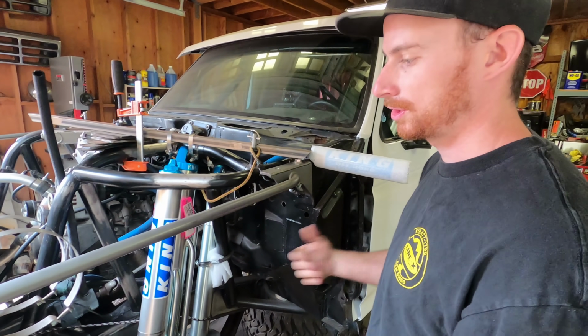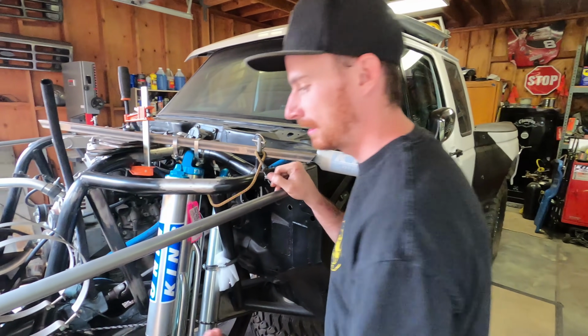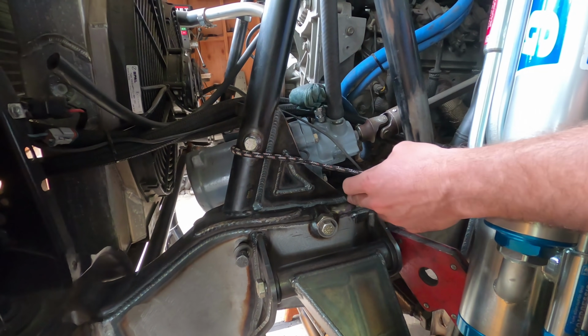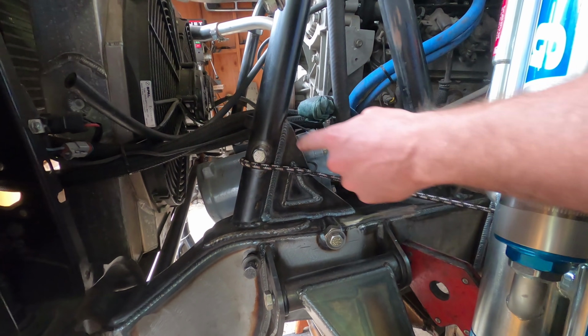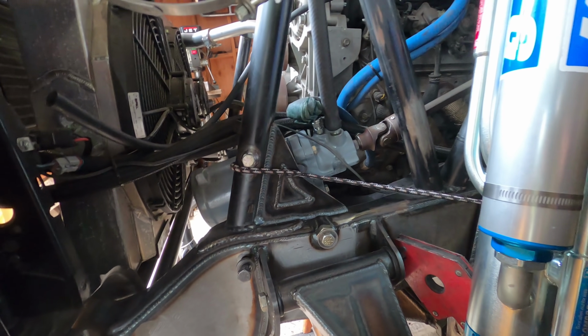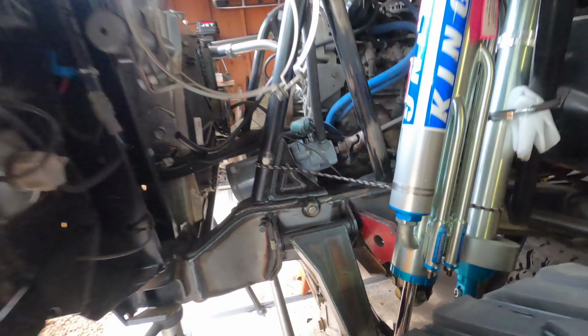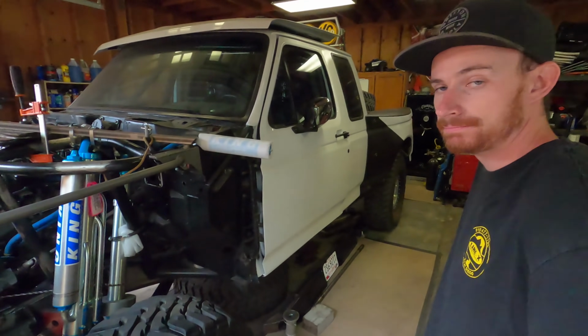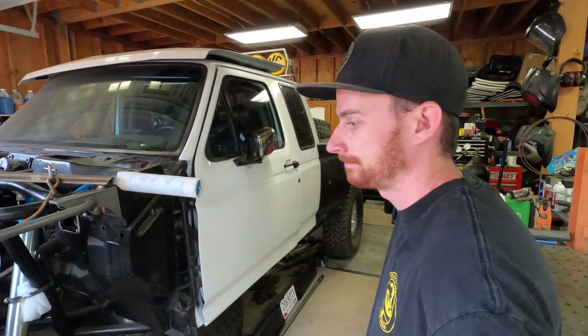So we had to push the box in just a little bit, and then once all the points were mounted, I went in and added this gusset as well. It's basically 3/8 thick material in there holding everything together, so it doesn't have a tendency to want to break off the truck. So yeah, there's no deflection or weird forces on the tubes or anything like that.